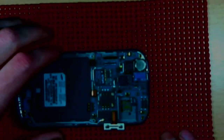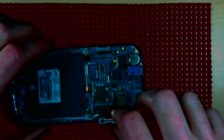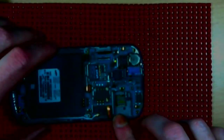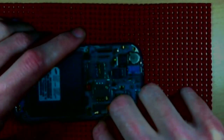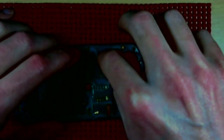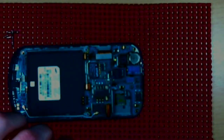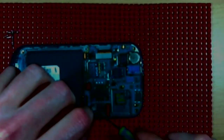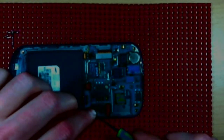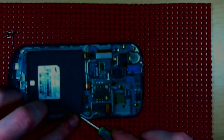Try and get this thing down carefully. Don't forget the volume rocker. Get the volume buttons back in place and go ahead and place your clips — one, two, three. And don't forget the coaxial cable, because without it you'll get no signal when trying to make a call. Just make sure you get it back in its little trench.